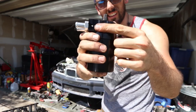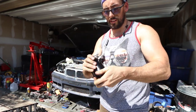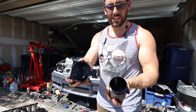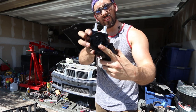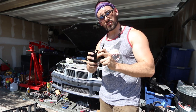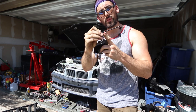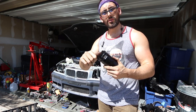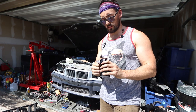If you look on this catch can it's nicely labeled — it says 'out' on one side and 'in' on the other. For a cheap Amazon part — I think I paid 25 dollars, I'll put a link in the description — it's actually decent for what it is. It's a hollow can with a little o-ring to seal it and a dipstick. It's got two baffles in there to help catch all that nastiness and collect condensation. It's not perfectly machined but for 25 bucks you can't beat it. I noticed the dipstick didn't come with an o-ring, so I bought a spare set of o-rings because I don't want any vacuum leaks. I'd always suggest getting an extra set just in case, especially if you order a different catch can — they may not come with o-rings.